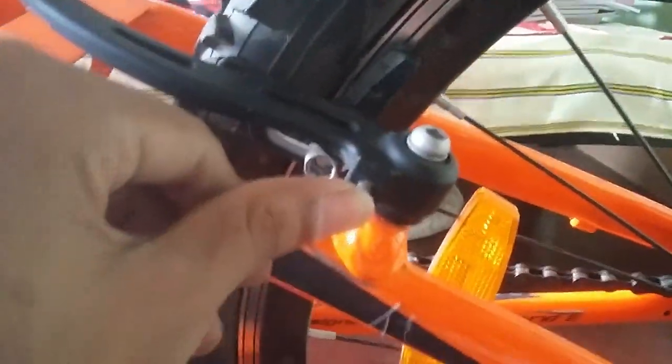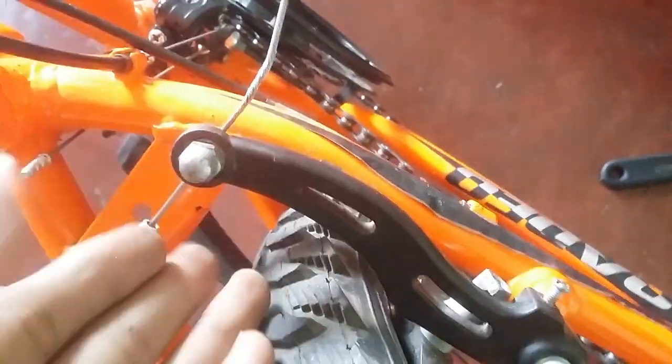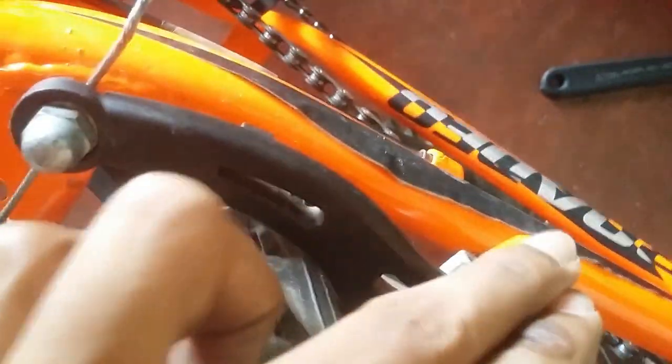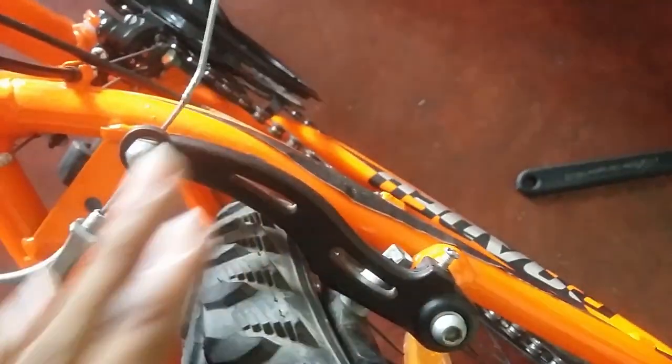You can see here there is a screw, and here is a spring located in both of the calipers. Screws are here to adjust these springs in both the calipers. So what happens is when you tighten the screw up, the caliper goes outside — tries to get outside. You can do it when your rims are not in the proper manner — if your rims are bended or something happens, you can tighten it so that your caliper comes outside, so that the power brakes behave in a good manner and give you better performance. So to avoid friction also, if you loosen the screw, the calipers will move towards inside. If everything is right, you can use it to tighten your brakes for far better performance.